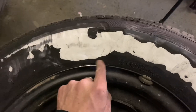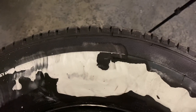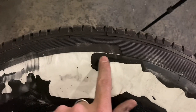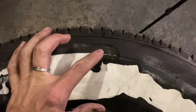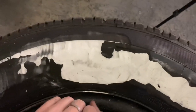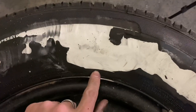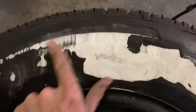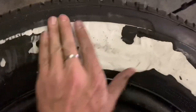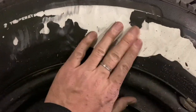What you can do is find your upper line first and do that all the way around, then you know where your edges are so you can freely clean out the middle. The upper part is pretty easy — the inner bottom edge is the most tedious part. For spots that aren't quite clean, don't worry about it. You can go back over lightly with the grinding wheel and clean it up, or use steel wool or scotch-brite to finish it off.